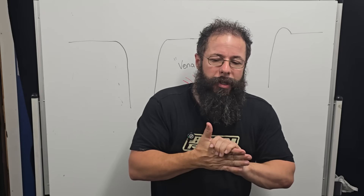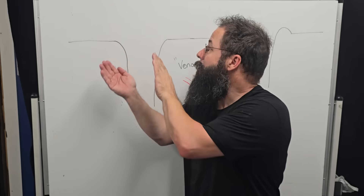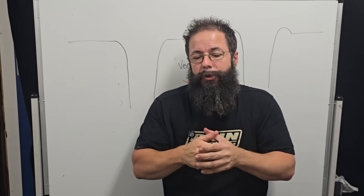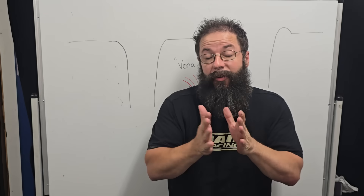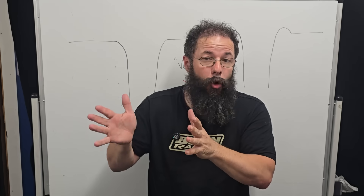It's a great question, and the simple answer is: this sort of stuff is designed for average; this sort of stuff is designed purpose built. We purpose build every single intake for a specific engine combo. We went through this with the big block build series — into the mathematics, the cylinder head, the cubic capacity, our RPM targets, and we built the intake around it. We showed an extra 72 horsepower over the US average of 40 horsepower. No flow benches, no nothing — pure mathematics.